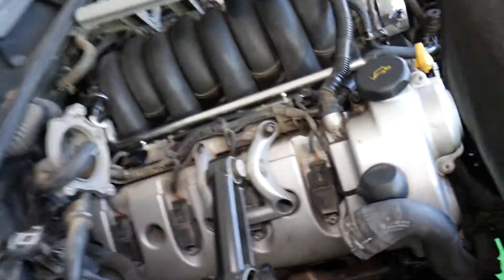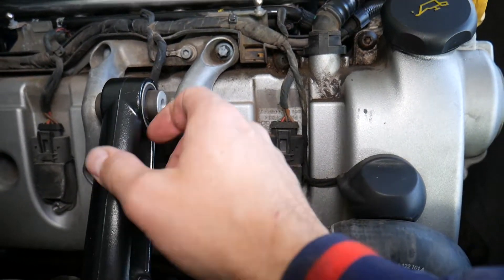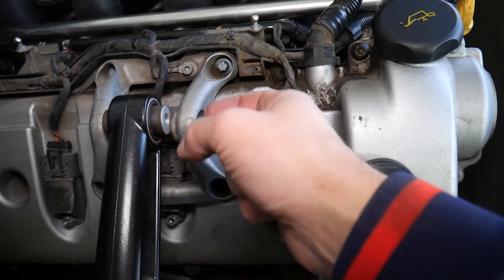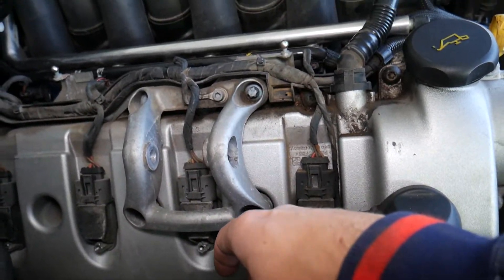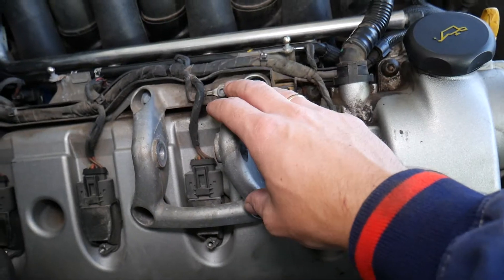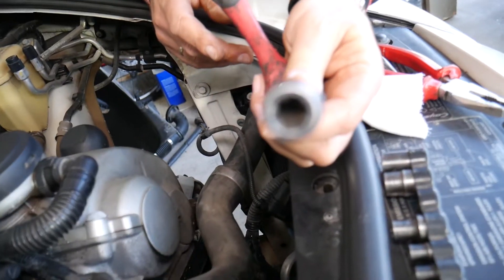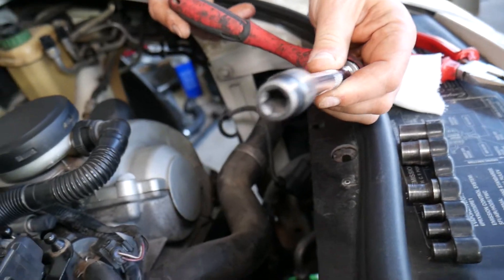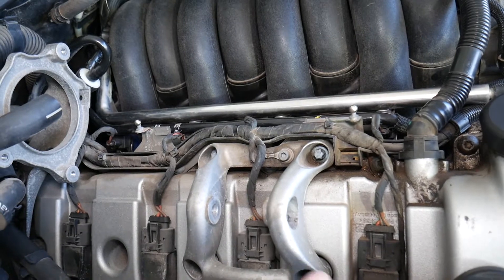But we're not done on the other side. After removing the plastic cover, you will need to disconnect the engine torque mount — that bolt needs to come out. Pre-loosen that bolt first, then get that bracket loose as well. There are four bolts with reverse Torx sockets on that bracket. Pre-loosen those bolts and remove the bracket, and you can easily remove that cover too and get to the ignition coils on that side.